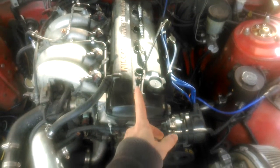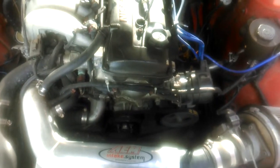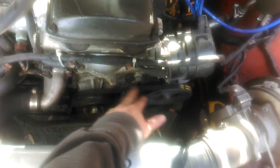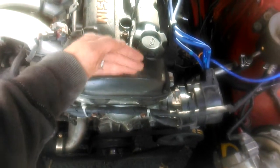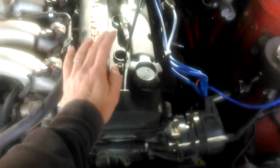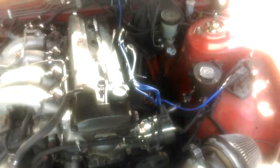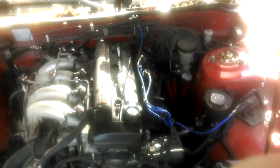Since this is a rear-wheel drive engine, the front of the engine faces the front of the car. On a front-wheel drive engine, the front of the engine faces either the right or left side of the car. The front of the engine is generally the side with the pulleys, belts, and coolant intake. Number one cylinder is always the one closest to the front of the engine, then number two, three, and four going back. When doing top dead center, you only need to care about number one. Hope this helps — like and subscribe, and feel free to ask any questions in the comments!